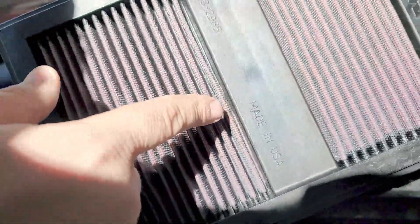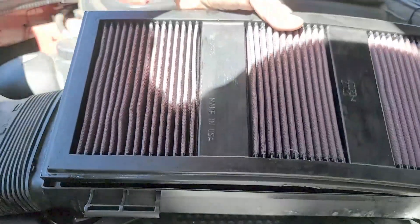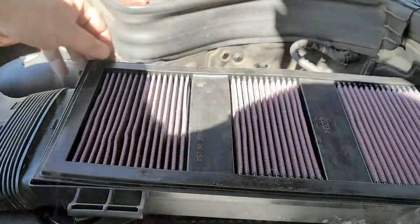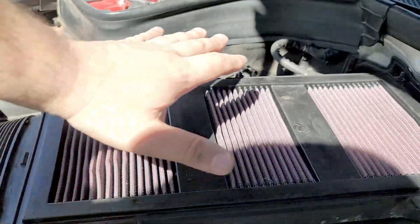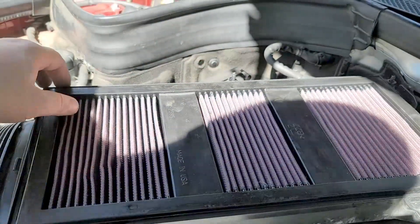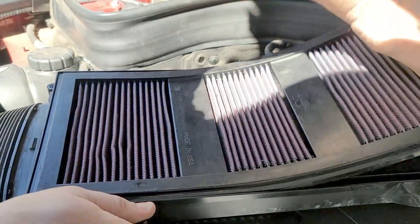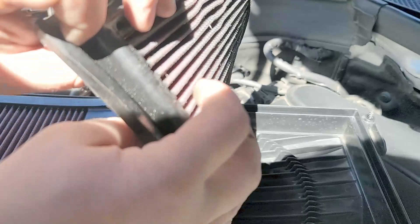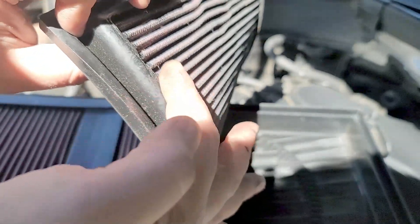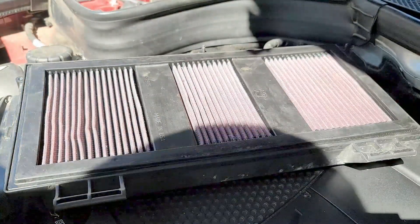As you see, this is clean enough. Yeah, there's some small stuff but I don't really worry about that. The K&N, made in USA — for this car the part number is 33-2985, in case you have a GLK 350. I'll leave a link below to this filter. It's made of some heavy rubber that really sits in place, it's not easy to remove — they're really good. It has a metal mesh before the filters inside.